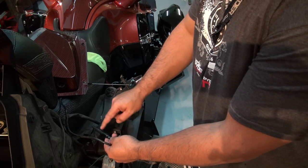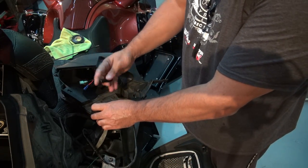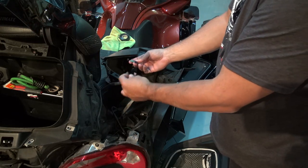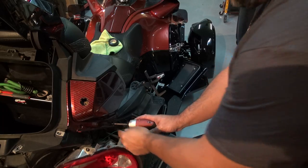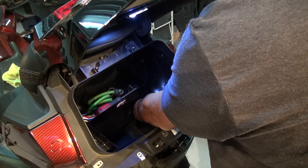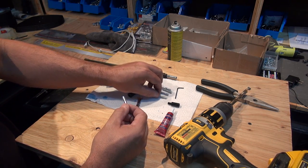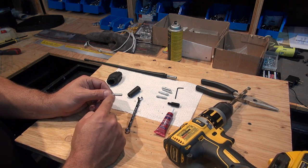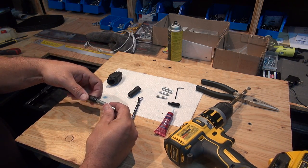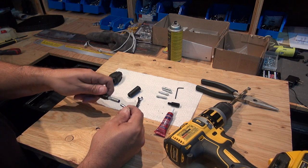When putting back the antenna, I suggest you go ahead and put some electrical tape. We have quite a few adapters — five of them. The one we're going to be using is the one that has the same threads on each side. The way you can check that is by taking your antenna and this bit, go ahead and just turn that in — it fits well. Check the other side as well — all good. So this is the one we're going to be using.